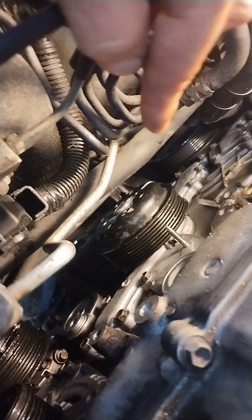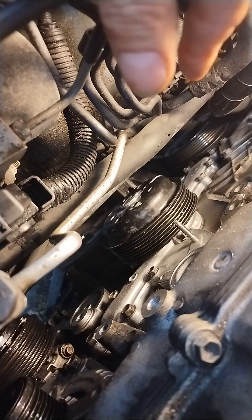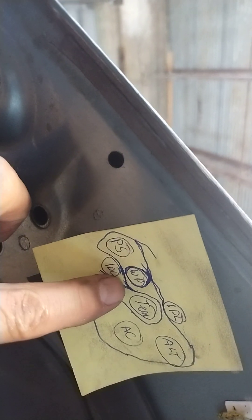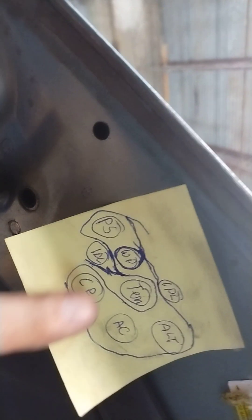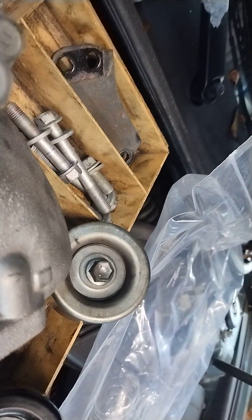When you're taking that pulley off to get the bolts out, make sure you leave the belt on first and always write a diagram of the belt routing. This belt is a real — don't pay attention to that little scribble line there because that one doesn't exist. The way this thing goes, the belt goes around the water pump pulley twice almost. It's really goofy and it's not easy to put on — we'll have another video on that later.